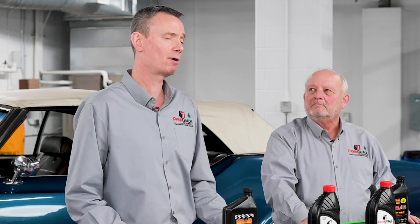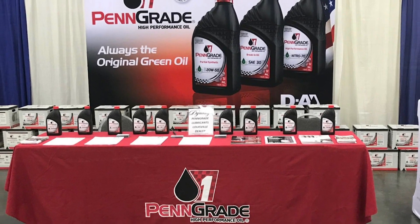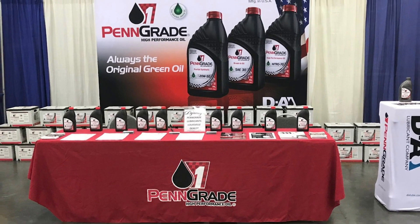Because multi-grade engine oils existed from the early 1950s on, some of the very popular multi-grade engine oils were the 10W-30 grade, the 10W-40, the 15W-40, or the 20W-50 respectively. And in this particular case, with this Oldsmobile Cutlass, I would likely recommend a 20W-50 considering how and when it's going to be used.